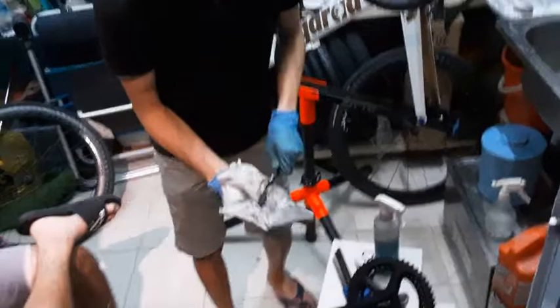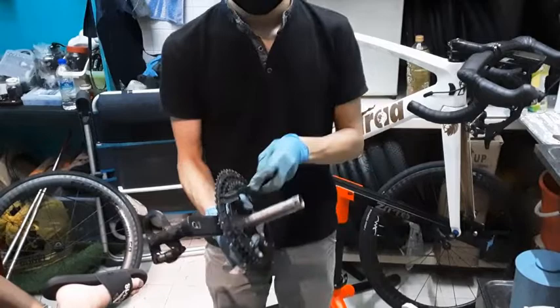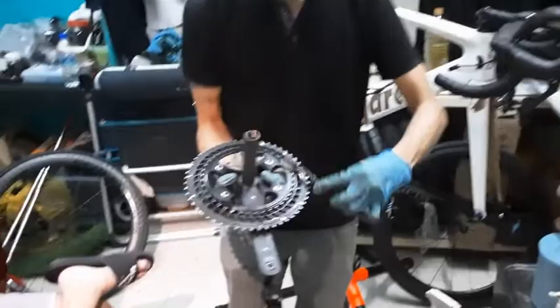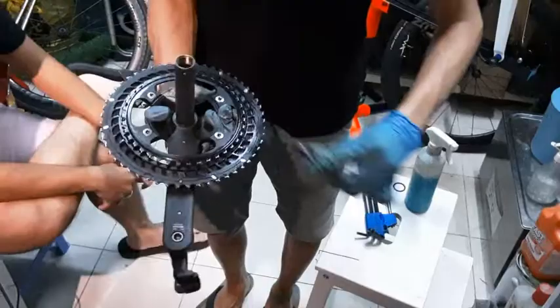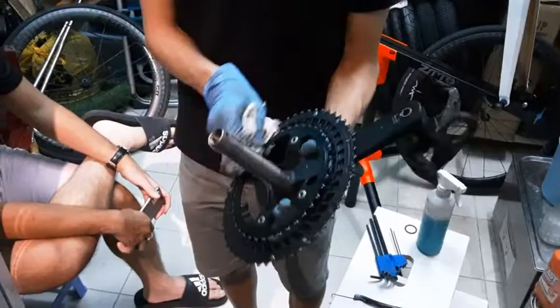So you usually take the toothbrush, spray the brush itself, and then start lightly scrubbing the one on the inside. Because this is for a quick home maintenance, brushing it downwards like this is best. And start seeing the exposed metal part instead, as all the dirty gunk rubs off. As you continue to scrub it, once you are satisfied, take a piece of cloth and start wiping it. Just like this.